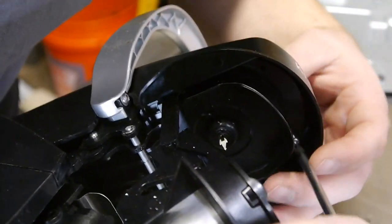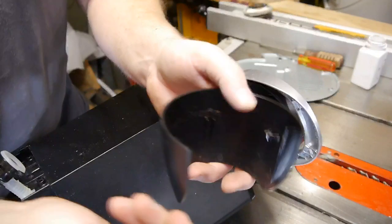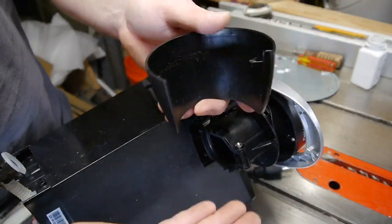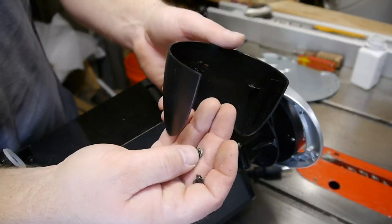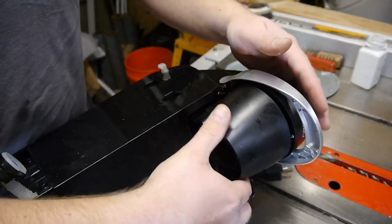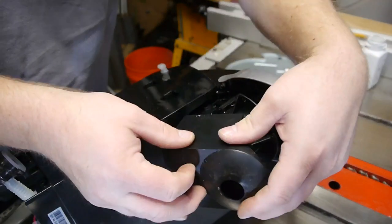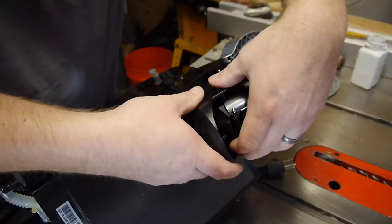Now, we'll get those two screws we were talking about earlier. It's always a good rule of thumb that when you take something off that's held on with screws, put the screws with it separately elsewhere in your shop, just so you remember which ones go where. But we're going to put on this fascia shield and these two thin flat screws with built-in washers here. But I almost made a mistake here. This has to get, at least, back in its home. Otherwise, it will not fit.